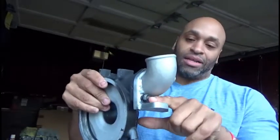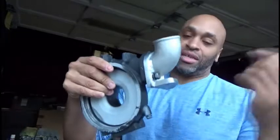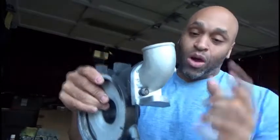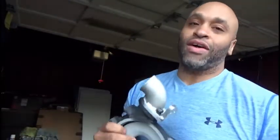If I were that customer, I'd be pissed to know that I went there with a certain kit and they cut it, tried to make it their own, pretty much destroyed the kit. If that person ever had to send that kit back, hopefully ISR wouldn't have noticed that. But it's one of those things where I keep telling you guys, make sure you're following directions. This is the reason why this is bent on the Evo 9: the turbo is a little bit bigger, there's less room, so they had to make this piece go this way. And this is actually for the wastegate actuator. So yeah, just make sure to follow directions.